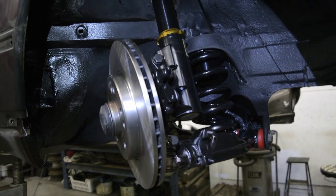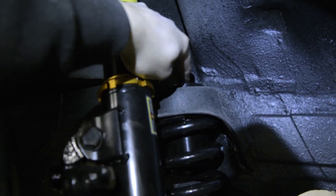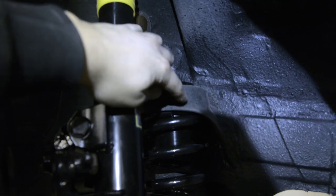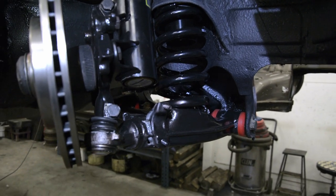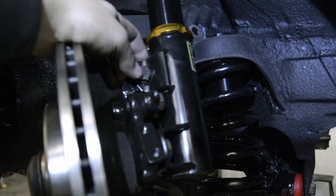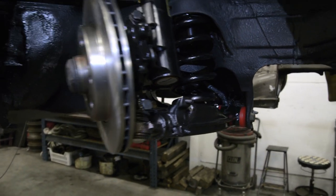I had the bolts in the spindle loose, so I put the spring first, then the adjuster piece at the top end of the spring with a bolt and a washer in the cup, and then just put the spring in place and used a floor jack to jack the control arm up and install the bolts at the lower end of the shock.